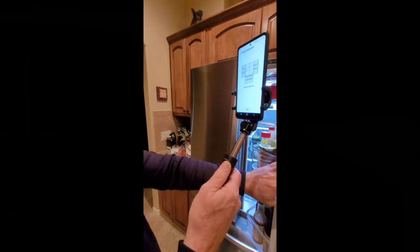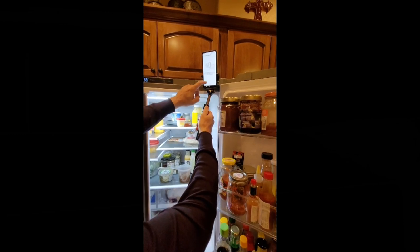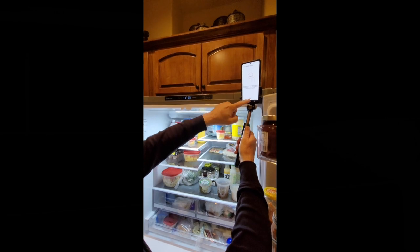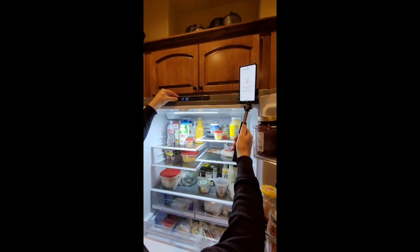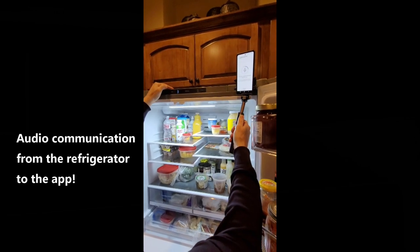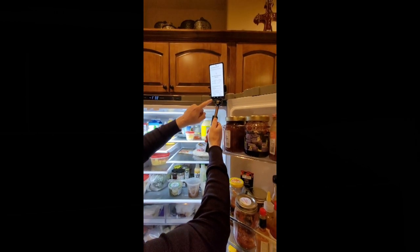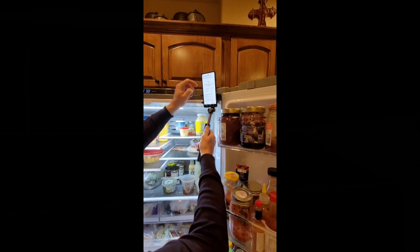Open the right door and hit next. Position the phone's microphone at the smart diagnosis logo — we have it there. Then come over to the freezer and hold this button. Press the next button and hold the freezer button down. It looks like it's rebooting. There we go — smart diagnosis is done. That sound was a message that went into the microphone in the app, which decoded it and said temperature is okay, evaporator defrost fan motor — everything is okay.